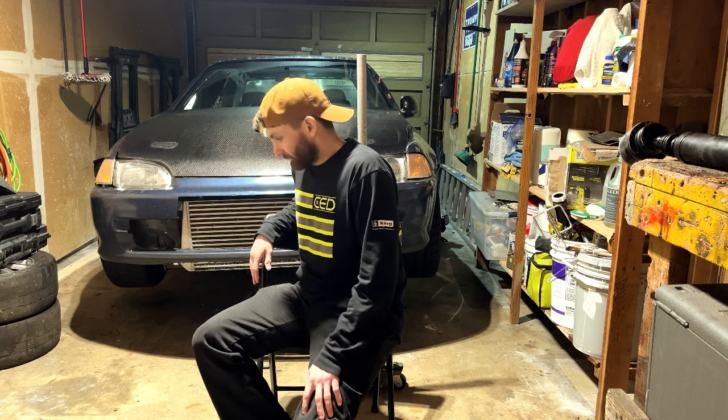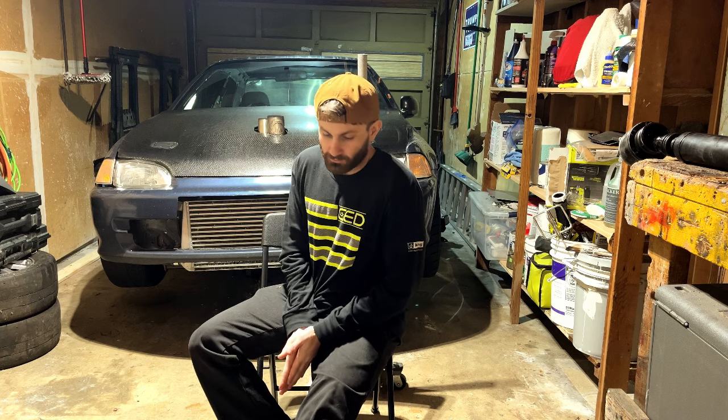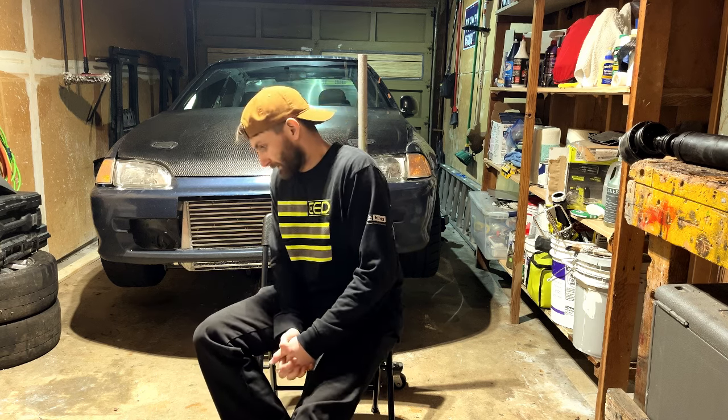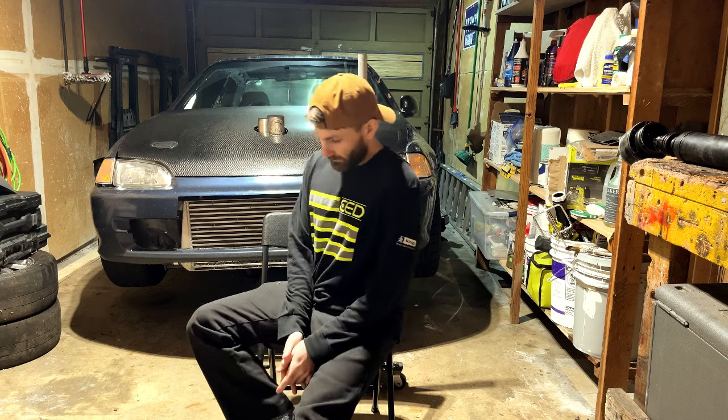I've been meaning to make this update video — the car, everything else seems to be okay underneath. I was worried about the transfer case being broken since it is a stock B-series transfer case. It does have a straight cut transfer gear on the end of the case and in the transmission. I did that because I didn't want to crack open the transmission; to run that transfer gear we have to put one on the T-case so it can mate up. It has a Speed Factory titanium dowel, a factory bracket that attaches to the bottom of the block, and it has a traction bar too, so the car launches pretty good.